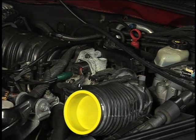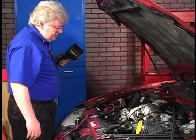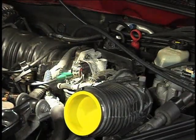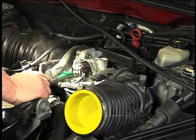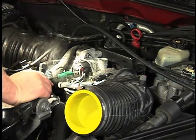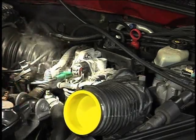Let's get our light ready too. Give it a few seconds, maybe even a couple of minutes. We see some smoke right now — right off the bat, I'm seeing smoke come out. And no wonder — somebody has done a little bit of jury-rigging of this vacuum hose connection on the side of the throttle body. That definitely has to be fixed before this car leaves the bay.